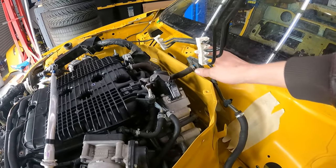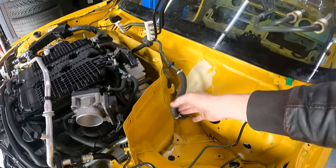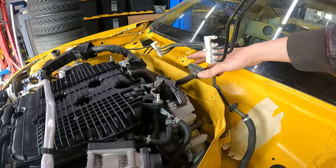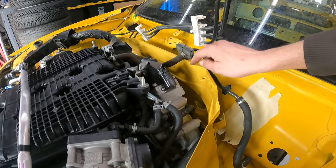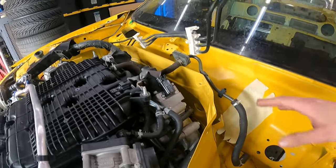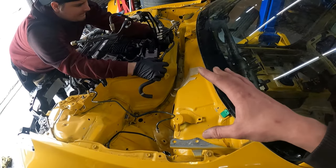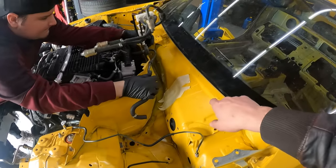What we've got to do is cut this piece of the firewall to fit the breather hose for the brake booster. We're going to measure the inside portion with digital calipers and basically make a template cut so this can slide into place — this lip has to be removed too, probably a little bit further back. After that's done, we can start throwing all the wiring in here and getting everything done for the 370Z wiring to get laid out and put into the cabin.